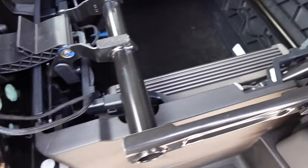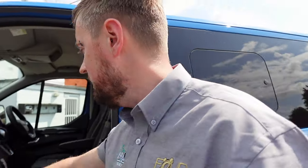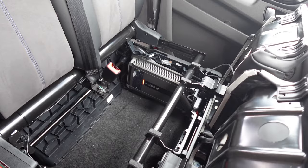That is a multi-channel amp designed to run front speakers, back speakers, and the sub. In this particular situation we've got front speakers running actively: two channels are running the tweeters, two channels are running the mid speakers, and one channel running the sub. Full control on the front end and bags of power — it's got loads of headroom. But still, all the space is still usable because we've mounted it on the side on a nice little amp rack.